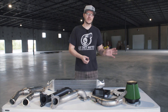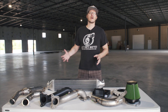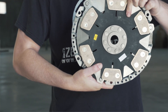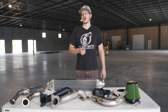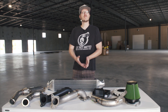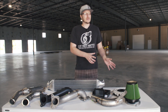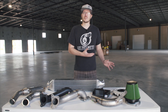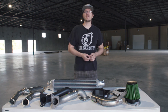So we've been opting for the Clutch Masters line. Our favorites right now are the FX350 and the FX400 — these hold up to Stage 2 power and beyond, even if you plan to do an upgraded turbo down the road. The drivability is great; surprisingly for a puck-style clutch, pedal feel is practically close to stock — a little stiffer but very livable and easy to drive. They also make a couple of different flywheel options. These clutches can be used on the stock dual-mass flywheel if you prefer, but for durability and some performance benefits they offer a lightweight flywheel option, which we recommend. It doesn't affect drivability too much, gives quicker revs, feels really peppy, and is a lot more durable — especially for drag racing, road racing, or auto crossing.